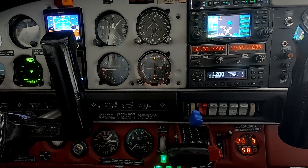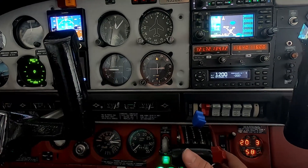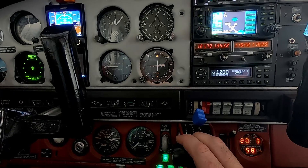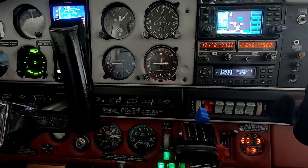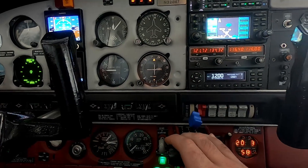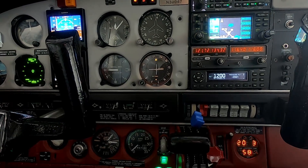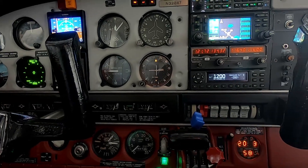The one thing I don't like is that at the first notch of flaps I get the gear horn — it's pretty annoying. If I'm just trying to slow down and throw some flaps in below 125 knots, the horn goes off and it makes passengers uncomfortable. Also today while flying, there's a switch in the throttle that's supposed to be there and serves a purpose, but it never really worked reliably. Every time we throttled back on approach it would start blaring the horn — you'd have to bump the power up or throw the gear down.